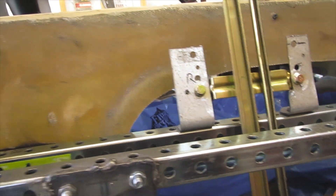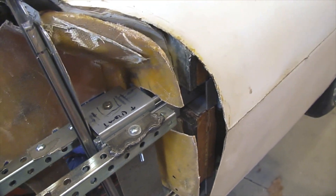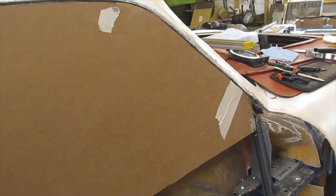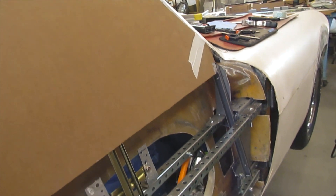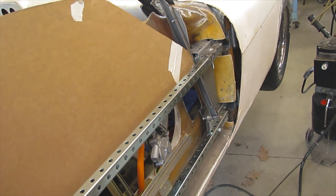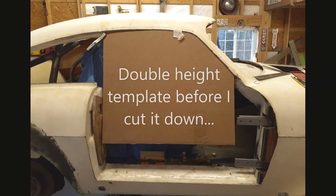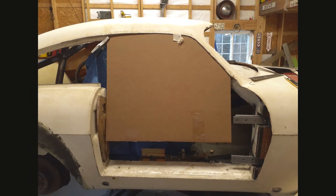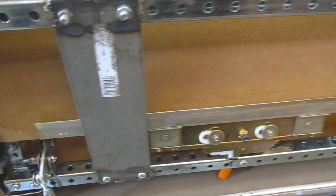First step was I started on the passenger side — I cut the shell and the inner door apart, and you see I put the inner door back in here now. I just temporarily mounted it in place to have something to build off of. An important thing you have to do is make a nice, exact window template — these doors don't have a window frame, so you have to be really diligent about fitting this template. I actually made a double-length one which showed the path the window takes going down into the door, to make sure you've got room for that window to come down completely. I used that to mock up my outer door frame, which was the first part I made.